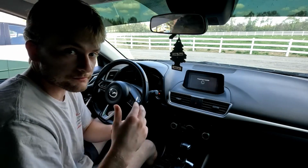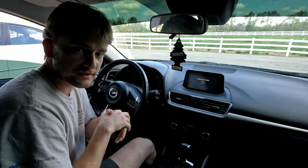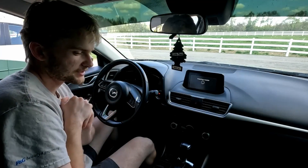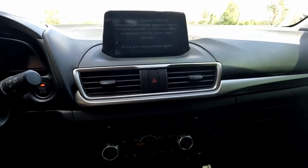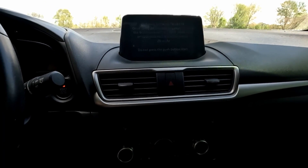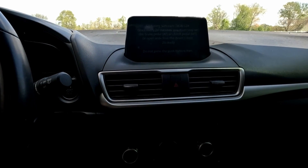This is a lengthy process — it'll take about 25 to 40 minutes to install the firmware from the USB into the infotainment system. All it says is 'updating software to firmware.' Note: once every 20 minutes, you must step on the brake pedal with an automatic transmission, or the clutch pedal if it's a manual transmission, or open and close the driver's door.